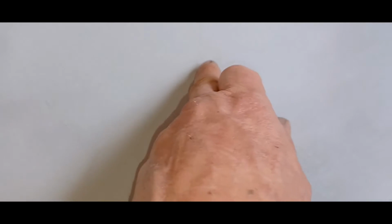But these dark spots are low spots. They're the same color as the guide coat you just put on. So you keep sanding until these disappear, guiding you in how far to go with the sandpaper. So we're just going to carry on until it's all looking like this, light gray. And then we know we've got it nice and flat and smooth. So that's basically the guide coat. I hope I did a better job explaining it this time, but now you got it.